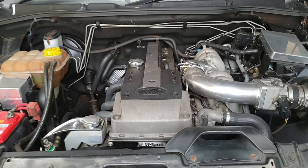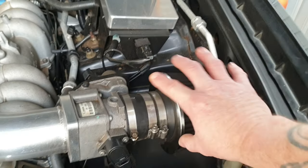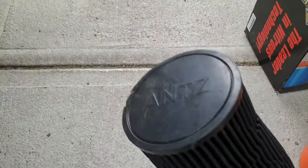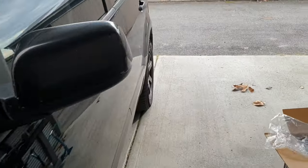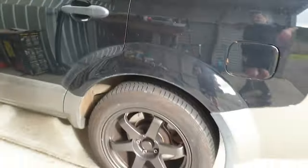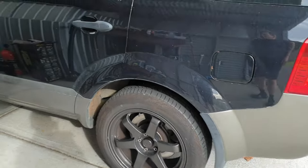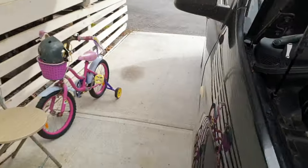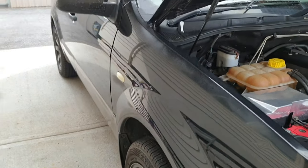There are a few other things we want to do. Obviously this sitting right here isn't ideal for intake temps, so I'm thinking maybe we'll put something down in there. We've got this nice air filter and I want to try and get that to fit. There's a new battery chucked in there too. On the back, I'm going to go for a 17-inch rim with the lowest profile tire we can get to really utilise those diff gears — they come with 3.7s from stock — to really shorten down that first gear. We'll change the air intake up, and there's also little things like the rust there that needs to be addressed.